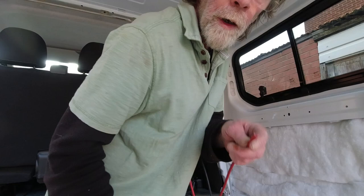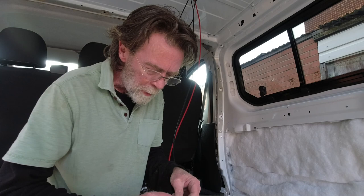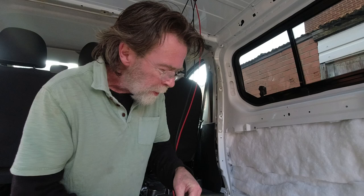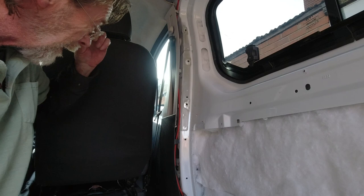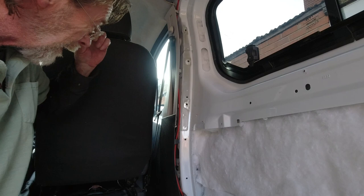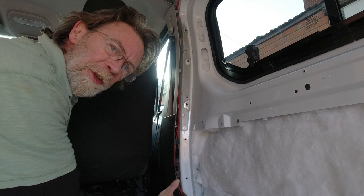I've got the tail ends from the solar panel here, and I assume they're live at this point — I'm not sure how that would be, but my assumption may be correct — so I'm just going to cover them up for now with a little bit of electrician's tape. Getting this behind this piece of panel would be very good. That's looking good — we've got this down this channel here, behind the trim clips for most of it. The charge controller is going to be about here, outside the battery box, so we can get quick access to it and see how everything is going. For now I'll push those wires in there, keep them out of the way, and that's the solar panel — everything in place.